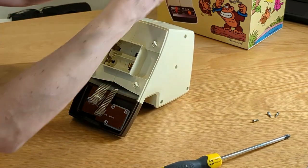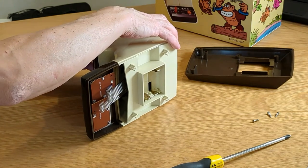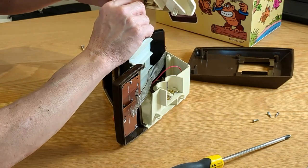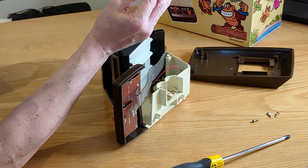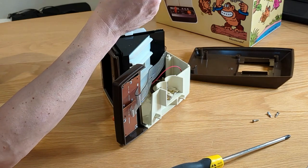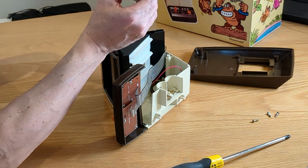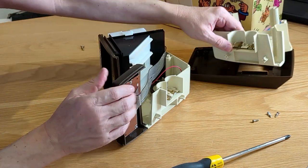So let's remove the back cover — pretty simple. That's the back cover. The sides are just stuck next to each other, so you just pull this off. This one doesn't have any cables or anything. The only thing you notice is the battery contacts here. If these are damaged or you feel they need to be set up, you just bend these little things over here and you can remove them and fix them. Also, if you want to clean them — sometimes I've used sanding paper to just clean the contacts and make sure they're working well. And then to put it back, you just bend it back so that it holds.